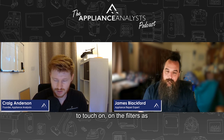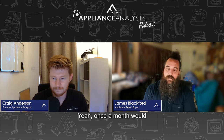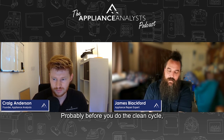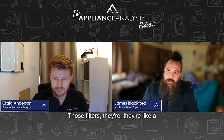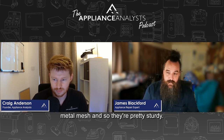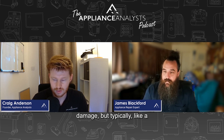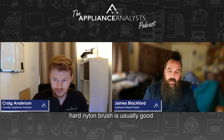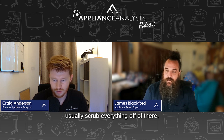Got you. Just to touch on the filters as well, about once a month, you'd reckon, to get in there and clean it out? Yeah, once a month would definitely be a good call, probably before you do the clean cycle, so it's got really good water flow. Those filters are like a metal mesh, so they're pretty sturdy. You could even use a wire brush to clean them without any damage, but typically a hard nylon brush is good. Just run it under hot water, and that'll usually scrub everything off.